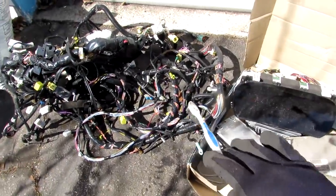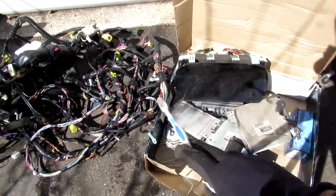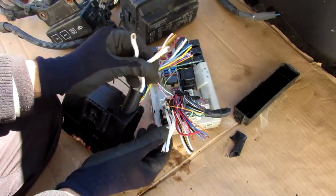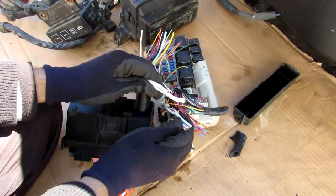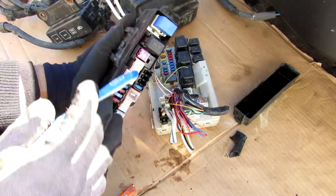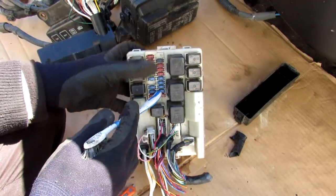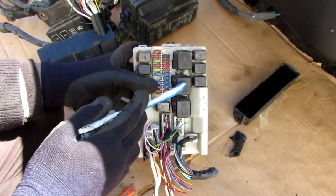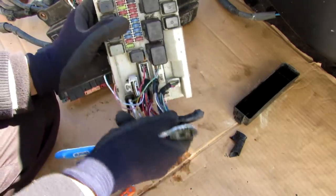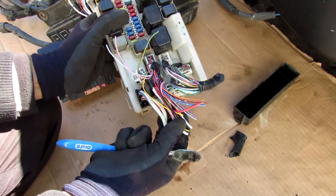I've got the entire wiring harness for both the body and engine, and all the computers, out of the car. The purpose of these intelligent power distribution units is to take power from the positive battery terminal through these thick wires, distribute it first through fusible links, then into smaller circuits through fuses, then into relays for individual circuit functions such as fog lights or turn signals, and then send those through much thinner wires to individual components like your radio or your ECU.